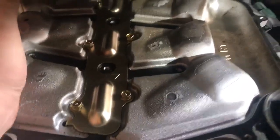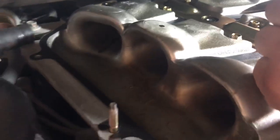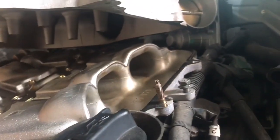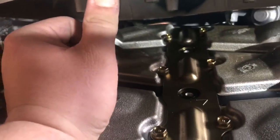I got lucky with a motor that doesn't consume a lot of blow-by with the oil. What we're doing with the spacer is addressing this front intake runner here. Because the top mount is a lot thinner as it gets to the front, that reduces the air volume actually received by that lower runner. With the spacer it'll lift that up a bit.